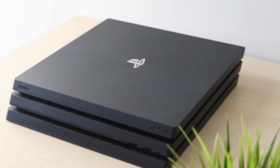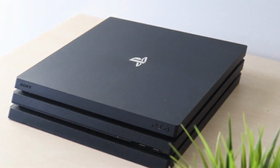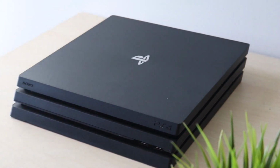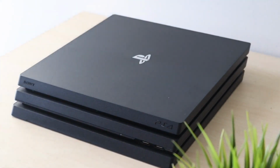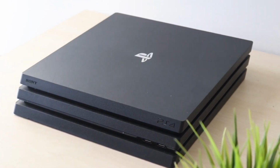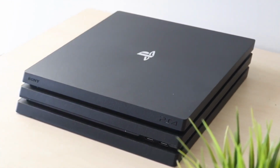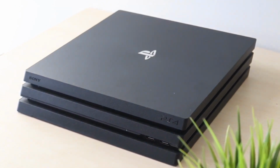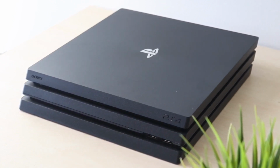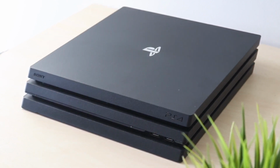to actually make sure that your PlayStation 4's HDMI port is fully functional and your TV's or monitor's HDMI port is functional as well. So by doing this, what I would recommend is to test out your HDMI cord and try plugging it into a different device that may need an HDMI, such as a laptop, Apple TV, Xbox, whatever you have. And if that seems to be working, then your monitor may be fine. And I would also try checking out your HDMI port against another console and seeing if that works, because you don't want a fried HDMI cord, which could happen sometimes.